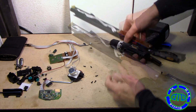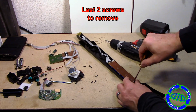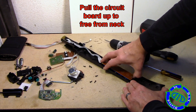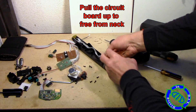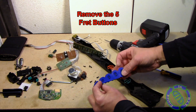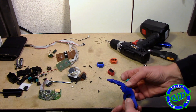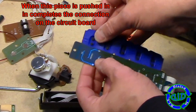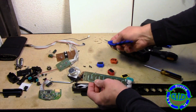I've moved on to taking the two halves of the neck of the guitar apart, and we're going to get the circuit board off of this as well. This particular circuit board has five little connecting points that, when you push the buttons, complete the circuit connection for that part — that's how it knows where and when you're pushing. This is accomplished by the blue part, which is the fret button pads. The fret button pads actually have carbon-tipped elastomers inside them that, when pushed against the circuit board, complete that connection. You can see right here those two little pieces that push out — they connect right there on the fretboard.